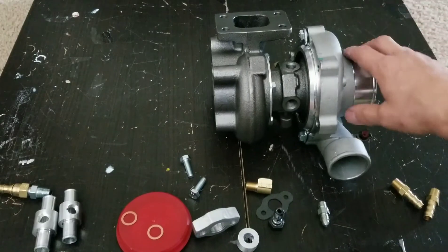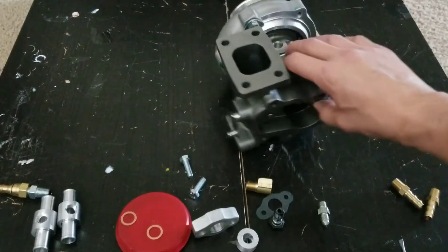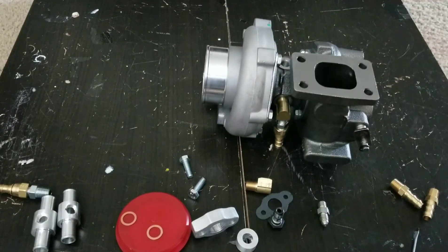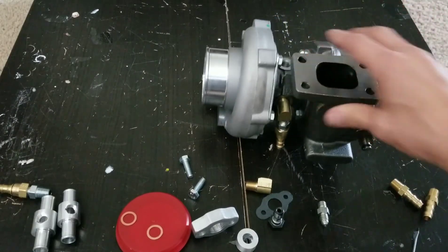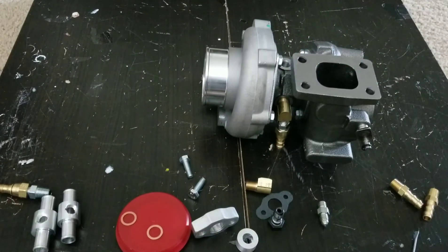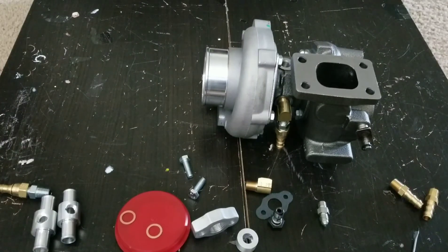Clocking is not a secret — everybody can do that. The overall assembly quality is amazing. I'm not sponsored — my channel has about 50 subscribers — but I hope this helps those 50 people if they need to deal with this. The T25 spools up faster and is way better than the T3/T4 for my application. My little Honda CRX with the T3/T4 was spinning too high — five to six thousand RPM and up. So I went to the T25, hoping to drop about a thousand RPM in the powerband — more useful for street application. Salute everybody and I hope this helps. Bye.